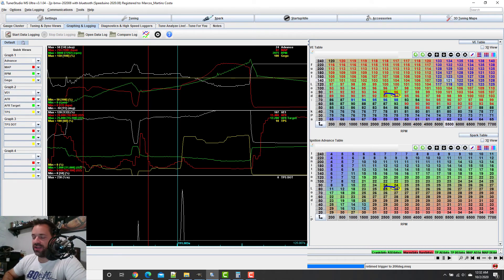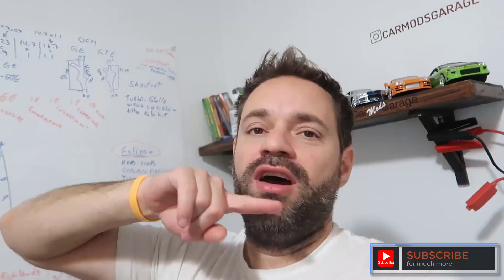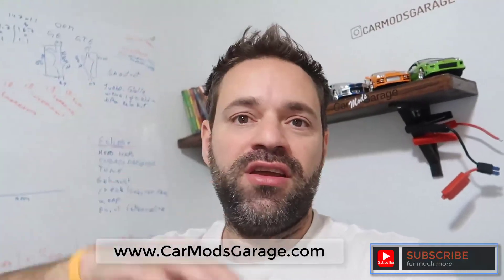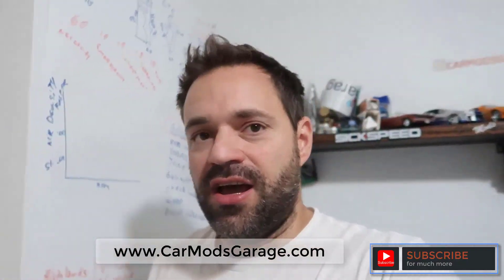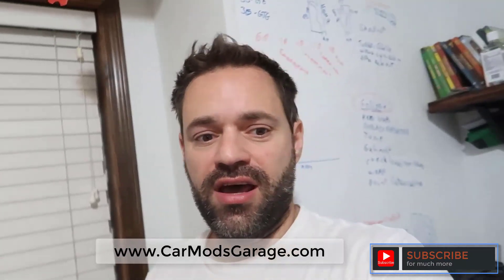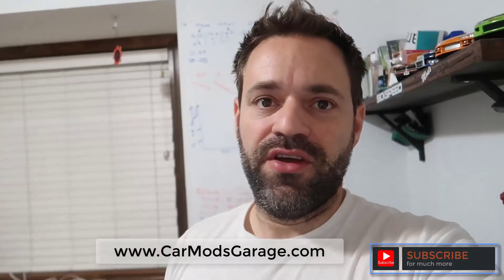That's pretty much it guys. I keep trying to make this video shorter but it's hard to explain what I need to explain — and I know you're probably tuning like me and don't fully know either, otherwise you wouldn't be watching. If you do know more, please leave a comment — I'm learning, and the more I learn the more I can help people. From here I'm going to go for another ride tomorrow — slow — and make sure nothing is crazy around any of the bands I changed, get another log, and repeat. This is a process I've done five times already because I changed spark plug gap, then the trigger edge, then timing was incorrect, and so on.